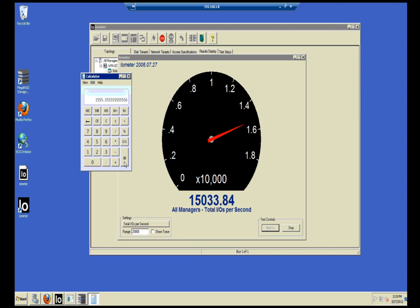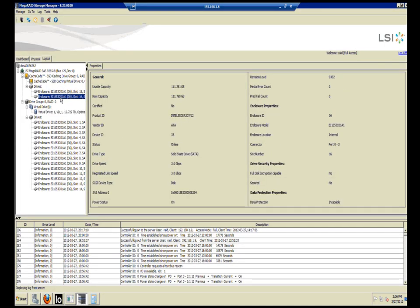Yeah. So, right, from a low-performing drive, I mean, they're storage grade, but they're not the top enterprise performance grade. Right, yeah, not for random, but you can leverage them with SSDs. Correct. I mean, you can add another RAID array. And that was a question I was going to ask. While we let this run, is there a way to split this where I could have another virtual drive underneath here, let's say a RAID 10? Can I split those off? I can't divide the SSD caching that I have right now and say, okay, this is going to be part for this virtual drive and another part for another virtual drive.